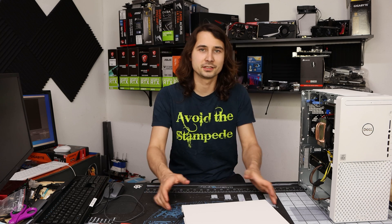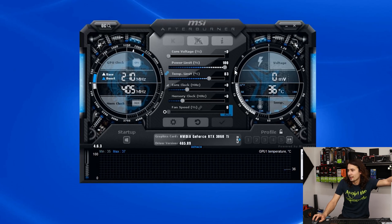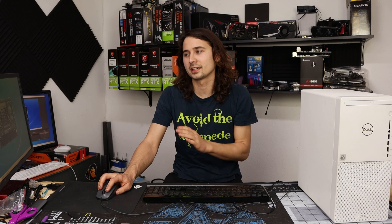So I traded him out and he's really happy about that. When you download MSI Afterburner, the power limit is stuck at 100% max. Now on a 3060 Ti that's 200 watts — that's the most this card is going to pull under pretty much any circumstance. The only reason you would need more power is to perhaps boost a little higher and get your manual overclock slightly higher.